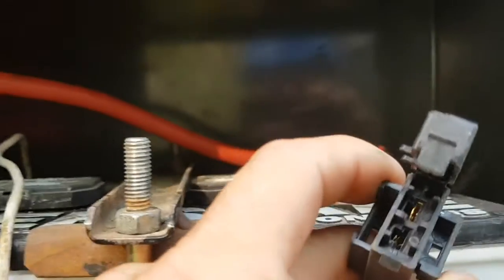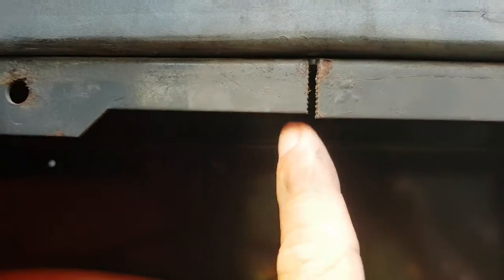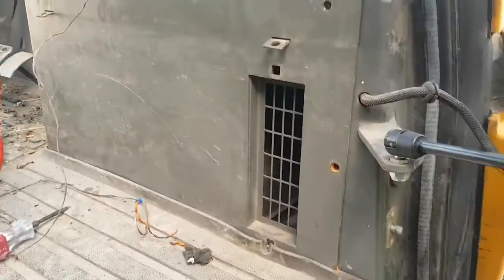And over here in another situation — very bad connection right here, nothing really hooked up. And they had these wires, you can see they're all getting chopped. This one's cut through already. Luckily it's just the ground. Had it pinched through here — looks like a bunch of saw blades. Also going through metal over here as well, straight, no grommets, jagged metal right on the wire.